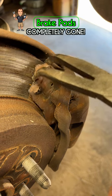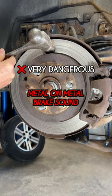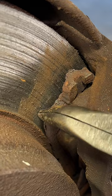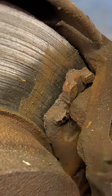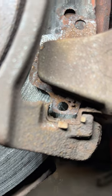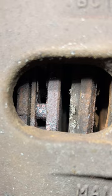The brake pad just about left the caliper — you can see it popped up out of the holder. Metal on metal is just what it's called when the brake pad material in here is totally worn out, which caused a lot of wear to the rotor right here. That thin rotor allowed enough space for the pad to slide up and out of the caliper bracket.